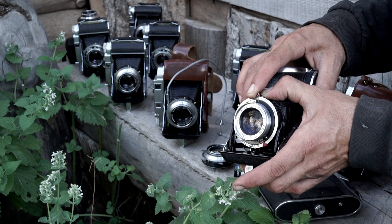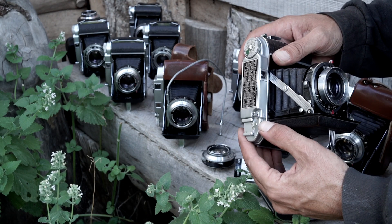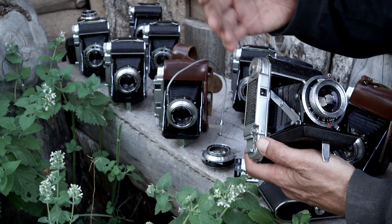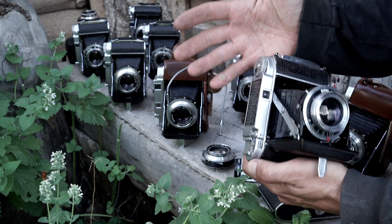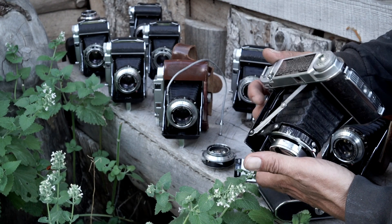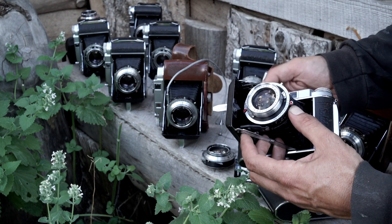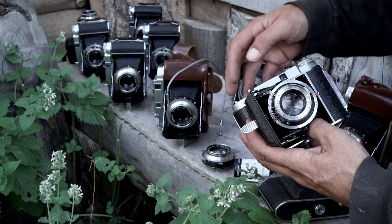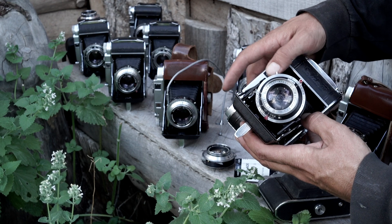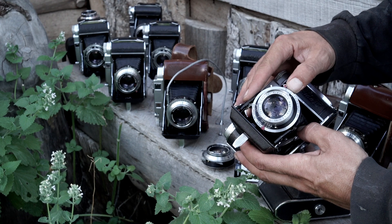The wind lever you pull back like that — there's a timer switch right here. In bulb mode you can lock the shutter open and then close it by pressing that back down. Pretty simple camera, did the job, nice and small, fits in your pocket. The shutter is nothing more than a button here which moves a lever right there. The self timer is a little sticky on this one so I'm going to help it along — I haven't used it in a while, but it still works.